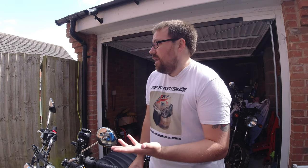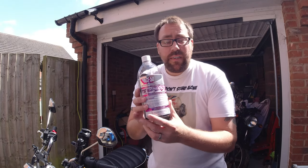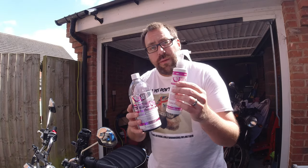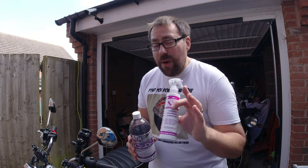Okay, let's just talk about the things you're going to need to do this. So you're going to need obviously a bucket of soapy water, a hose pipe or something to rinse it off, but what you need to order is the ACF50, and make sure you get yourself a decent tub and get the one that comes with a little spray bottle as well. I'll go through the steps as we do it, but let's just start off with quite quick and simple: give the bike a clean. That simple, clean the bike. Step one.